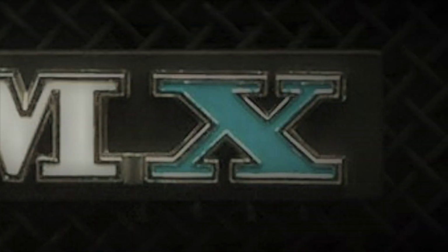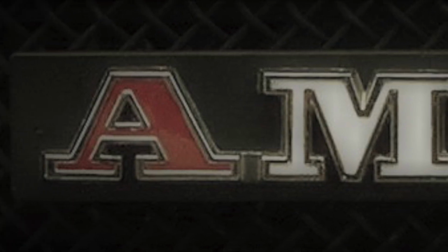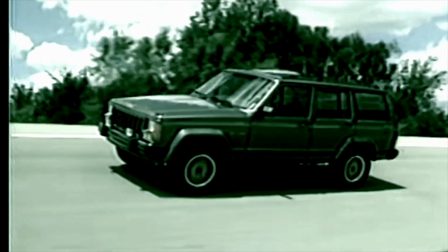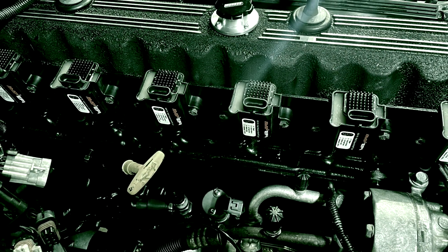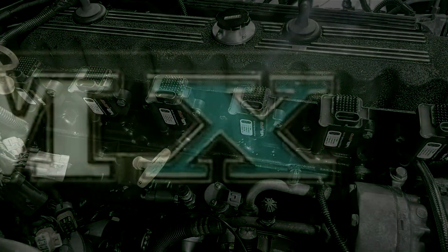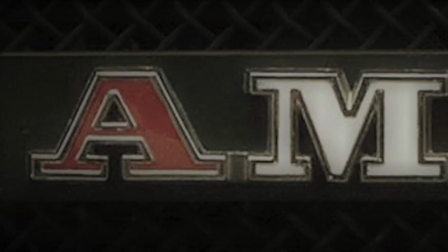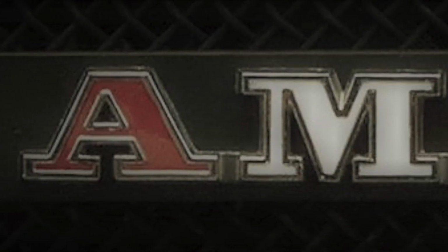In a 4-liter, made-over, fix-it-as-you-break-it AMC motor. That's just incredible. And that didn't even have the killer head that I had developed for the 4-cylinder. If I had put that killer head on there, that thing would have probably run 820s. We've got to get some people to start building those things. Most guys want cross-flow heads, but you don't need it. The only problem with the U-flow head is that it heats up the intake. But if you put your thermal tape on the header pipe and all around the intake manifold, especially the bottom where it really heats things up, you're going to be in pretty good shape.